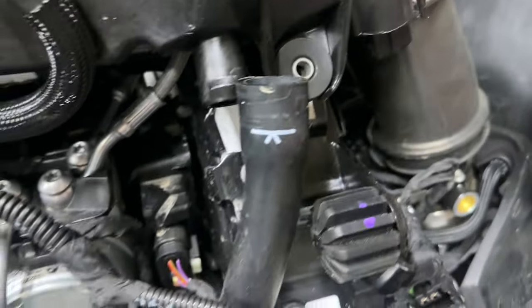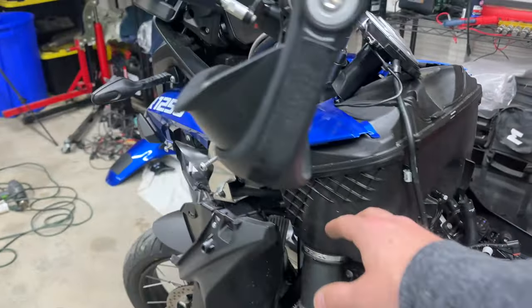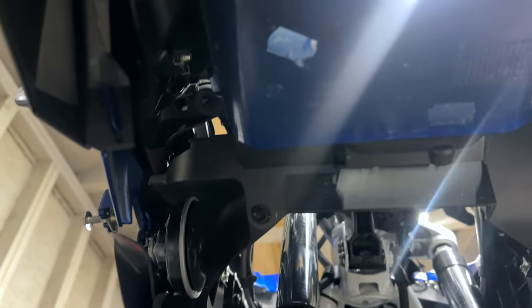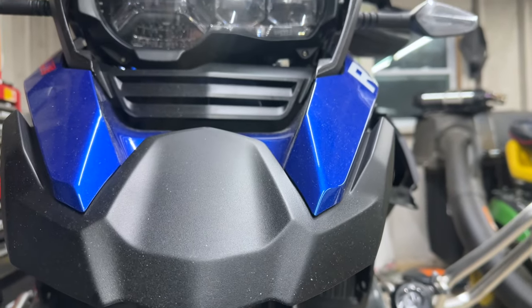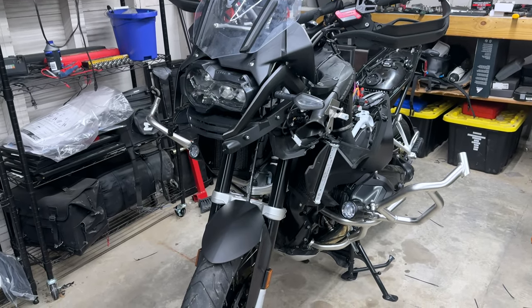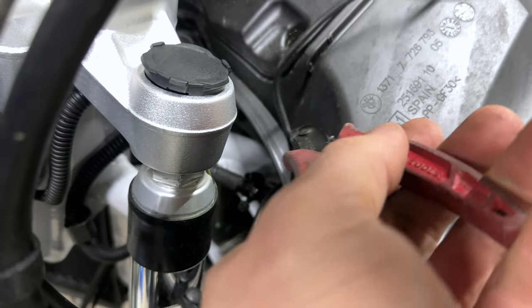Did those two T40s, did that hose. I think we're very close to getting this pulled out. I'm going to remove this upper fairing — there's a T25 right there that will free this. That one T25 is your last step to get this guy to pull away. Congrats — now your GSA looks like an Africa Twin. I also found another zip tie here, so make sure you replace that zip tie after you're done — that's for the fuel level sensor.